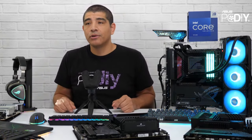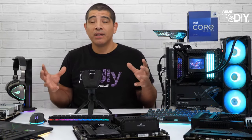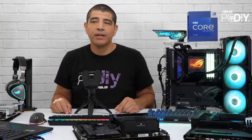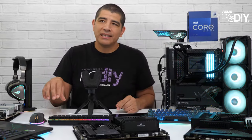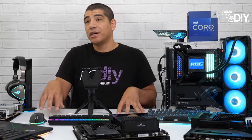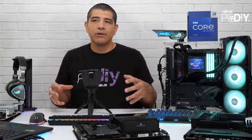The nominal footprint that you tend to see when you're talking about PCI Express drives is probably somewhere around SATA speeds to first generation PCI Express drives. So somewhere between about 500 megabytes to maybe one gigabyte worth of actual throughput being realized on the drive. So you don't have to be super stressed about, do I have to run it in PCI Express Gen 4 mode, right? Or, even if I have a reduction, running it maybe in PCI Express Gen 4 by 8, none of these scenarios are really going to affect you.